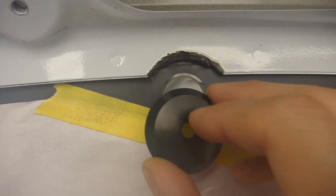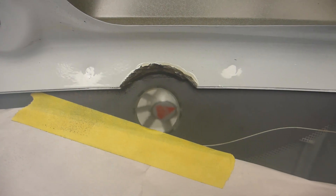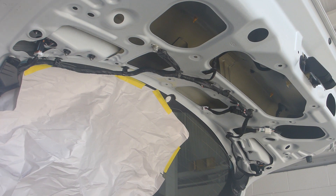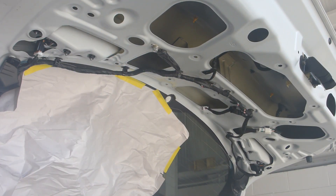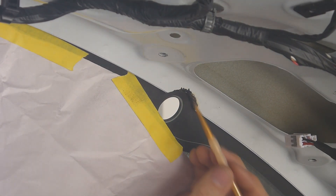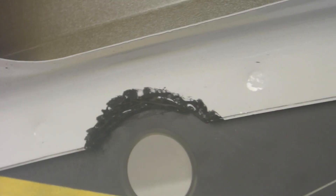That's the finished result after trimming away, and you can see that we can fit this plug in there with absolutely no clearance issues. Now, even though this little cut section right here is never going to be seen, it is exposed metal, so I tend to like to paint over it with something. This is just some Testors model paint — it's matte black. Just something to cover an exposed steel edge. I painted it a little extra heavy and wide, so it's not going to win any beauty contests, but it is going to prevent any rust or corrosion from starting and forming on that metal. We can remove this paper now.